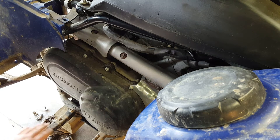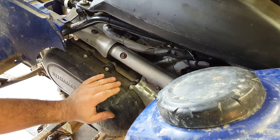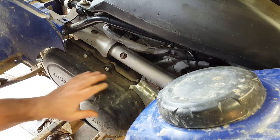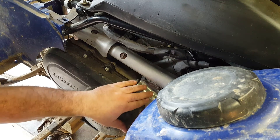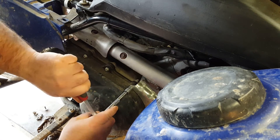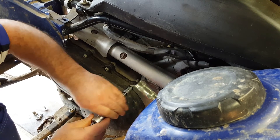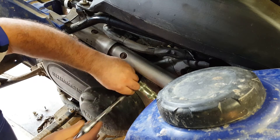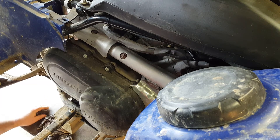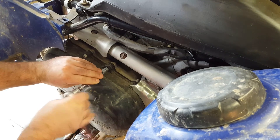So I've removed the footwell from the right-hand side of the bike and the farm bars and bits and pieces. And now we've dug down to the plastic cover that's on the right-hand side of the engine. And behind there is the CVT drive. We've got a ring of bolts to remove and this bracket as well. And once that's off, we can pull the cover off and it'll give us access to that belt. Just be aware that some of these bolts are different lengths to others, so you might want to make a little pattern on the bench when you put them down as to what goes where. It just makes it a bit easier when putting the whole thing back together later on.